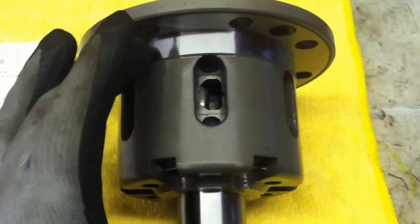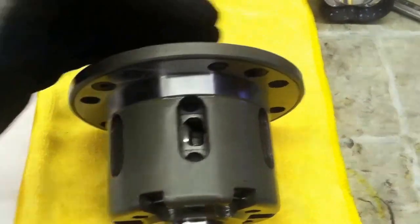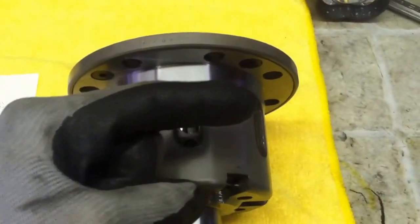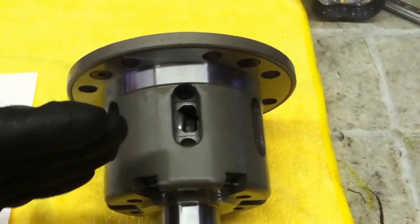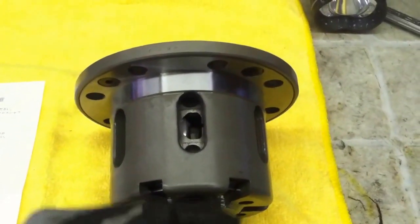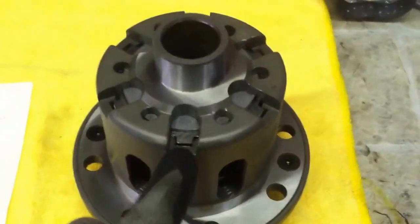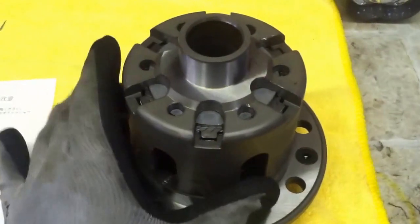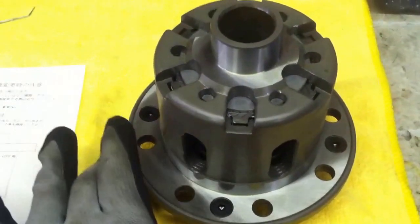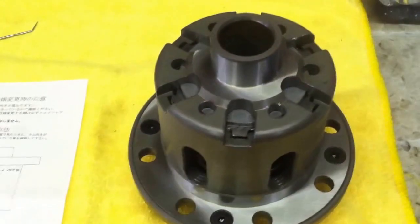The key for these diffs is setting the initial breakaway torque, which I'll show in the next video. Anytime the right side and left side of the differential are traveling a different distance, you are overcoming the initial breakaway torque. So when there's no significant drive or coast torque — say going down the back straight at Mid Ohio or up the front straight at Road America — if you're not letting the car run completely free, the distance difference between the two sides is being absorbed by the clutches. Getting that right is what's really key for the spec Miata, so you can get drive off the corner without absorbing power down the straightaway.